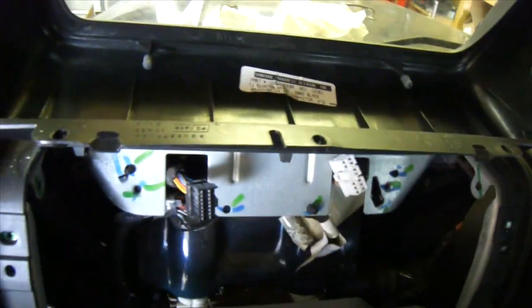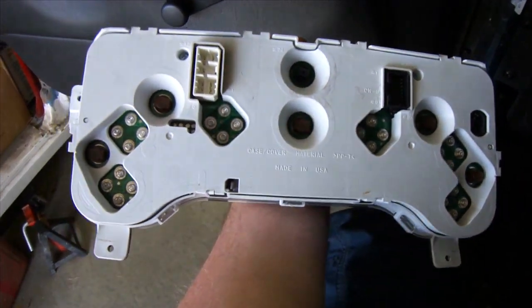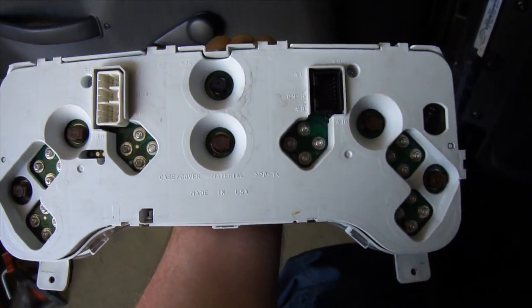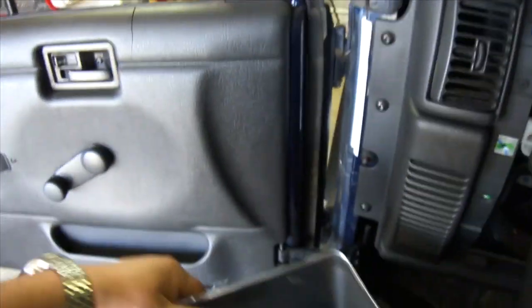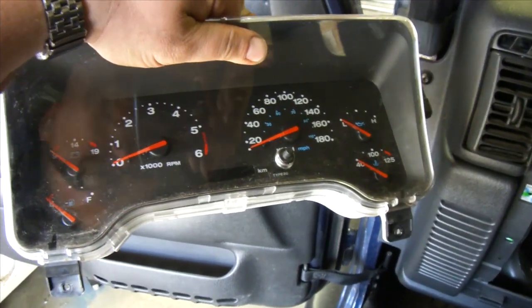There you go — access the rest of the wires. There are two wires that go in the back. On the back of the cluster you've got two lights on the left, two lights in the middle, two lights on the right, and your two plugs. All connections are labeled. There she is — takes you about 10 minutes to rip that out.